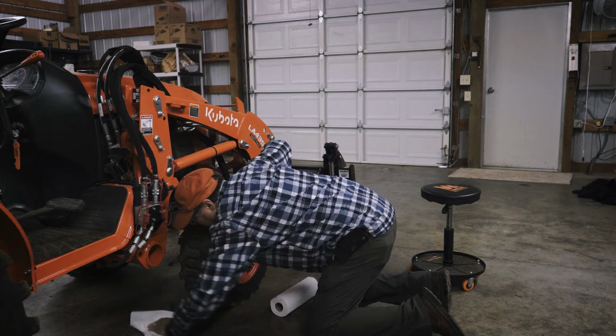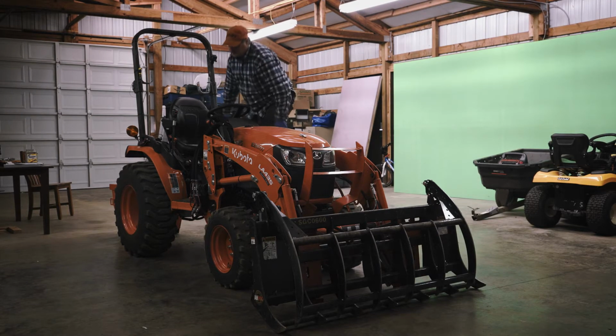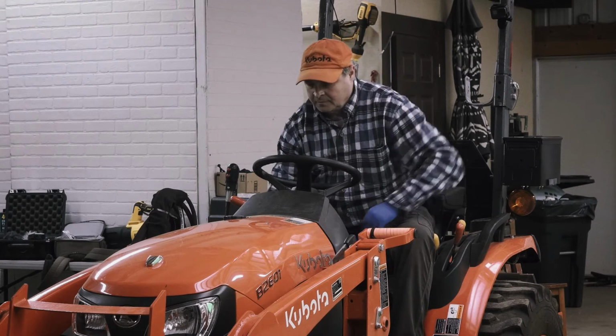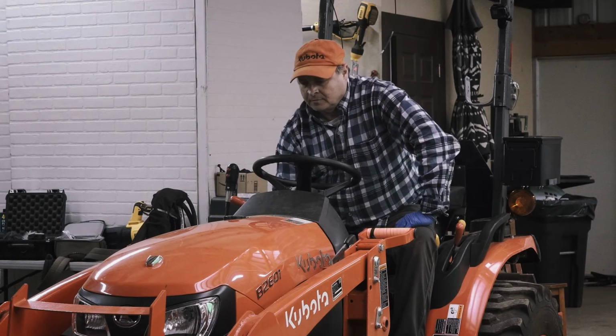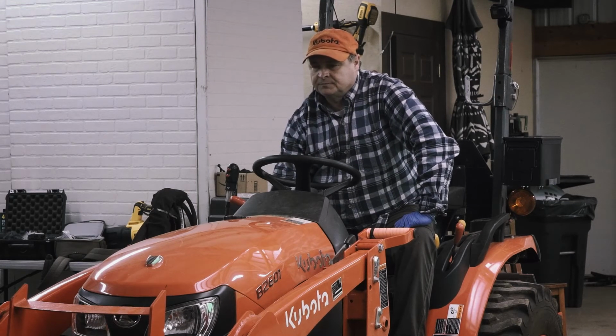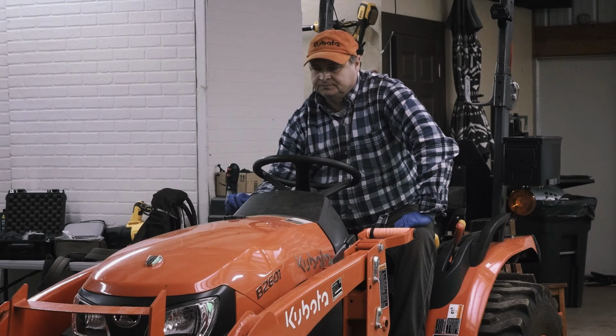Lastly, bleed the air from the fuel system. According to the manual, the bleeding procedure is to fill the fuel tank with fuel and then start the engine and run it for about 30 seconds and then stop the engine. After 5 to 10 seconds, the air that was introduced into the fuel system should make your engine sputter. Give it a moment and the engine should recover on its own.